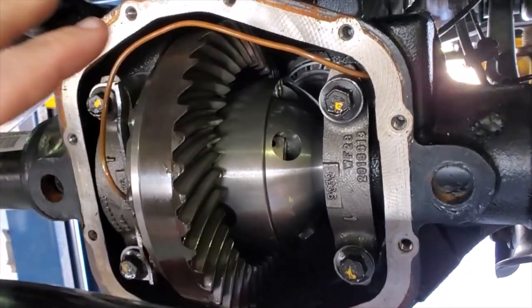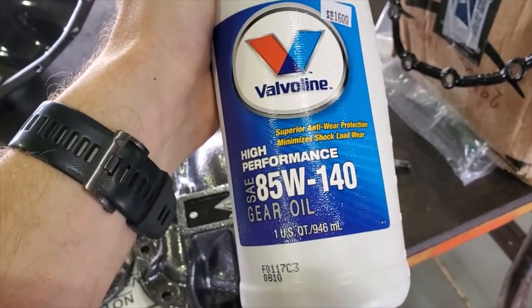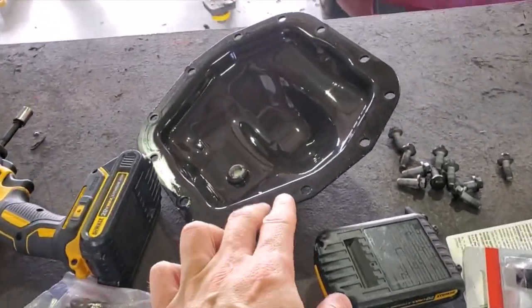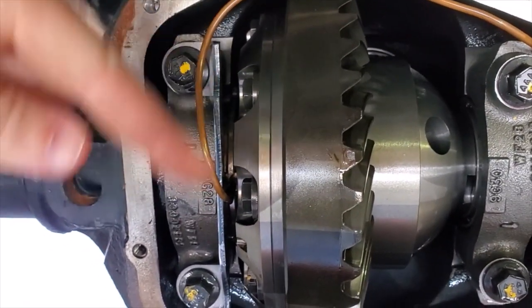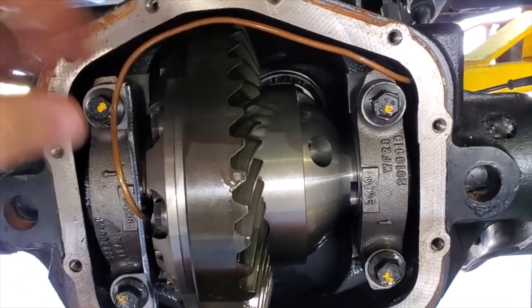I use Royal Purple gear oil — it was about a hundred dollars for the initial fill. You can use cheaper oil and break them in with whatever weight you want. I actually switched, per ARB's instructions, to get rid of the Royal Purple. You want to use a regular 85W-140 gear oil, because the Royal Purple has a friction modifier in it that will wear out your Viton seals. There are Viton seals behind this location that seal the air locker against the airline. After maybe 10,000–30,000 miles those seals will start to go bad, your air locker will leak, and that's why a lot of people have problems with air lockers.